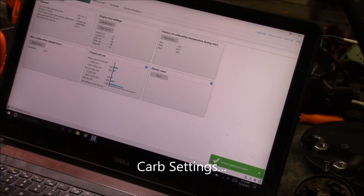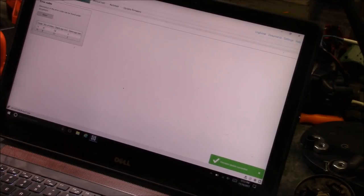It's had 9 hours of running on it. The current low is 10 and the current high is 90. The minimum high is 64, the max has been 98. So this saw is trying to lean itself out. It was operated in very cold weather, and 90 is a flag to me. There are two numbers that bother me — first is that 10 on the low side, which points to an air leak somewhere. If you've ever listened to this saw at idle, you hear it kind of go 'mmm' — a little high then drops down. Almost every one of those saws is going to have a code 13 or 16. This one has got a bunch of them: code 13 has occurred 47 times, and it has it every time.